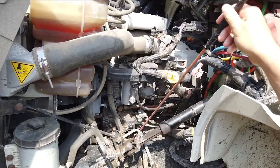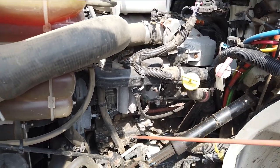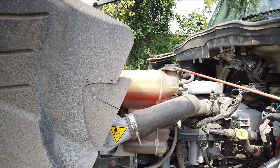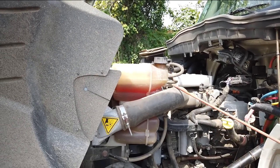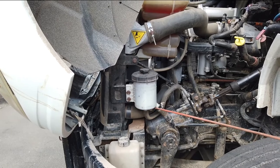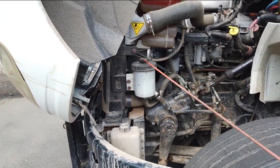Power steering pump: gear driven, tight and secure to the engine, no crack, bent, or broken, no visible leaks. Cooling reservoir: tight and secure to the bracket with the hardware, no shifted or loose, no visible leaks, cap present, no broken, crack, or chips, level between min and max. Steering fluid reservoir: tight and secure to the bracket, no signs of leaks, level visible from the side, should be between min and max, cap present, no broken, loose, or missing.